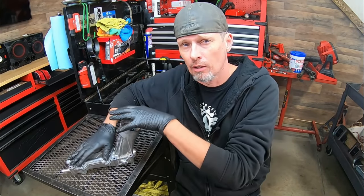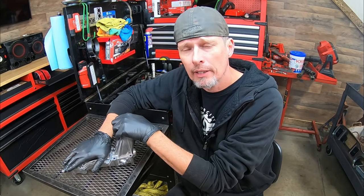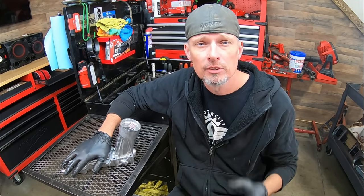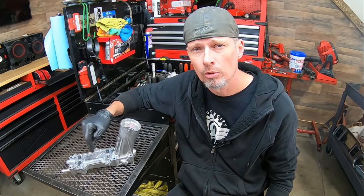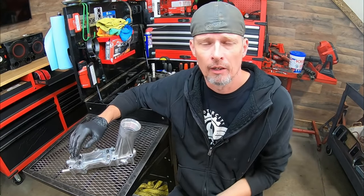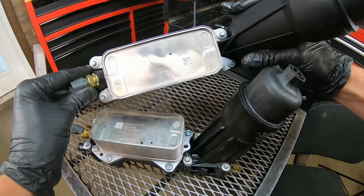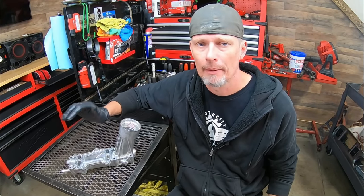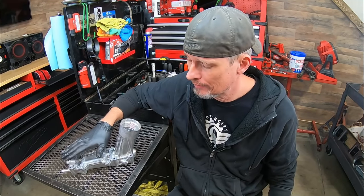I taught how you could actually install basically a Gen 2 housing on a Gen 1 engine — it was an easy swap. The reason for doing that was we had those issues with the bypass valve and that tower, and we wanted to eliminate that so it would never happen again. The only issue was making sure someone used the correct oil filter. The problem is you cannot install the Dorman part on a Gen 1 — while it would physically bolt up, the oil cooler assemblies are different between Gen 1 and Gen 2. So you're not going to have a replacement cooler. We don't have all the components to make the swap happen, and unfortunately we have to stick to this being Gen 2 only.